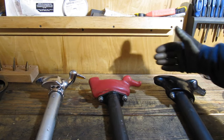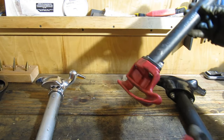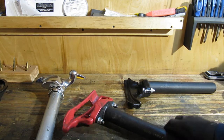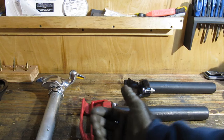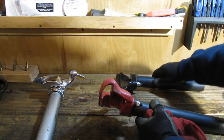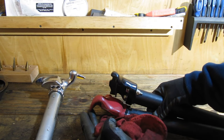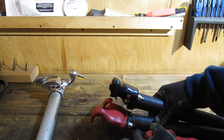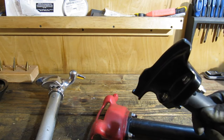I'll be interested to see if the tire rests against the rim when mounting with this tool. Another big difference between the red and black duck bills is that the red one has a flange that mounts under the bottom lip of the rim, whereas the black one does not. I wonder if the black one lets you get it a little bit tighter. The closest the red one can get is when its bottom lip hits the inside of the rim, whereas the black one can rest right against the outside of the rim — potentially making the tire stretch a little less to get over.